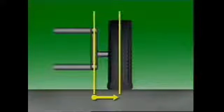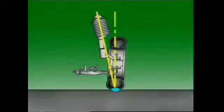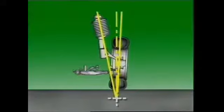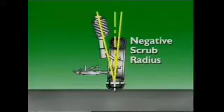The wheel would pivot on a radius with the steering axis as its centre. This would introduce a turning moment on the wheel. Road shocks would be transmitted back to the steering wheel and steering would be difficult to control. Steering axis inclination brings the pivot point close to the centre of the tyre contact patch at the road surface. It intersects with the camber line drawn through the tyre and the wheel. If these two lines intersect at the centre of the tyre at the road surface, then the vehicle is said to have zero offset or zero scrub radius. If they intersect below the road surface, it has positive offset or scrub radius; if above, then negative offset or scrub radius.